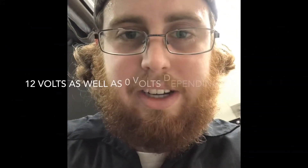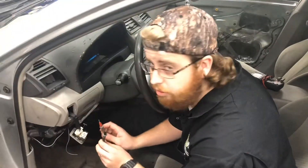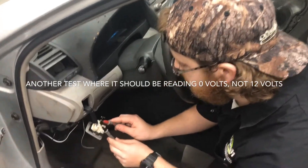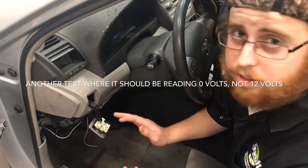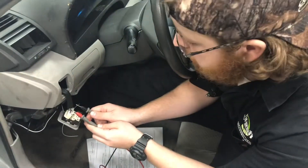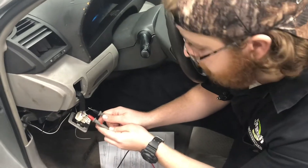As I am doing these readings I should be getting 12 volts drop, but our connector is not good and it's faulty. We're going to get 1 millivolt, but that's faulty because it should be battery voltage which is 12 volts. We are checking the voltage drop across pin 2 and 5 — we should be getting battery voltage of 12 volts, but again it's a faulty vehicle connector so we're going to get 1 millivolt.